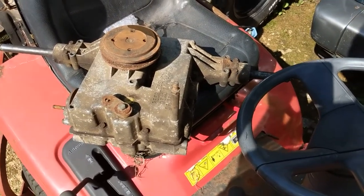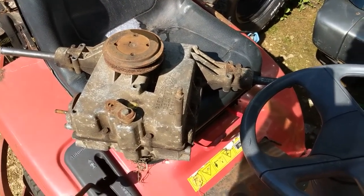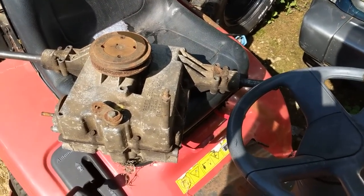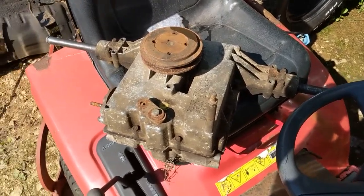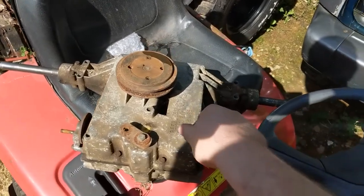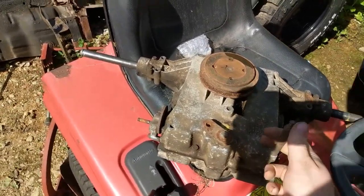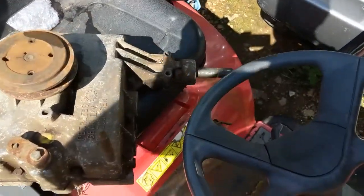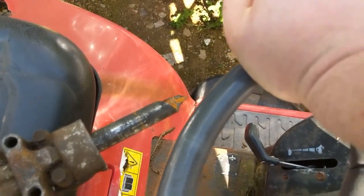Everyone on the internet says the 820 is the beast - it's got inch shafts and it's meant to be a ground-engaging transmission. But I can't find one in the UK, so unless one of you listening know where I can get one, leave a comment. For my search I think I'm just going to have to convert this into a bigger axle. I can get another one of these, but it's just going to do this again - I honestly don't know how it happened, I just pulled off the wheel and it was already broken.